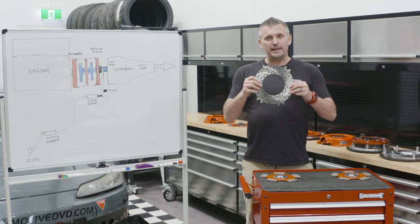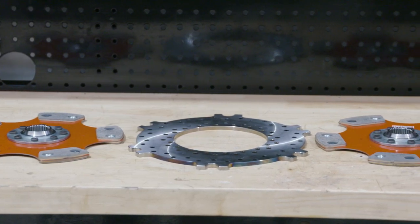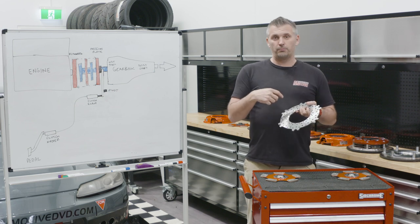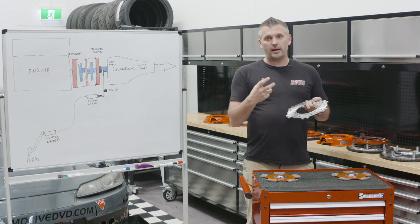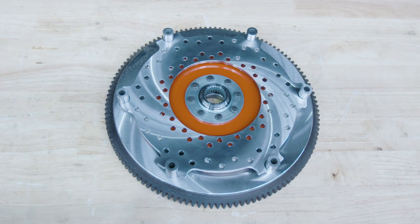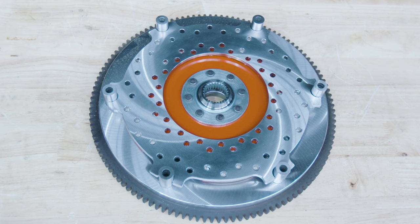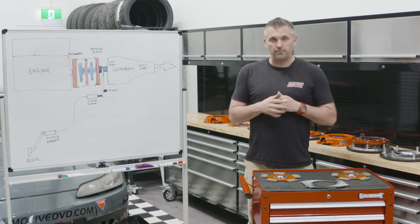So the next thing we're going to look at is the intermediate plate — this is the plate that goes between the clutches inside a multi-plate clutch. This one in our car has holes in it. Why? For two reasons: it takes a little bit of weight out, but much like a cross-drilled brake rotor, it allows the gases, dust, and material from the pucks to have somewhere to go. They can actually dissipate more heat through the holes, which helps stop it from distorting and helps it last a little bit longer. There is still plenty of surface area to transfer heat and friction. That's something the guys from Direct Clutch Services do on their twin-plate clutch.